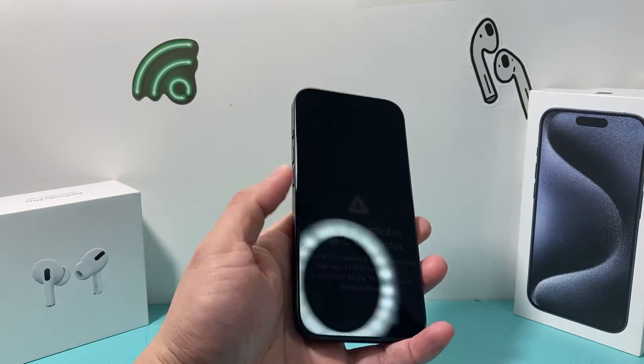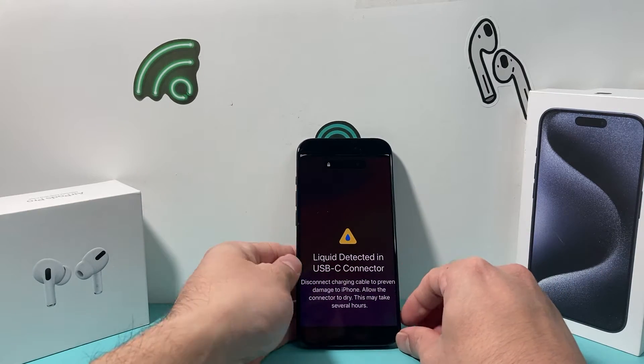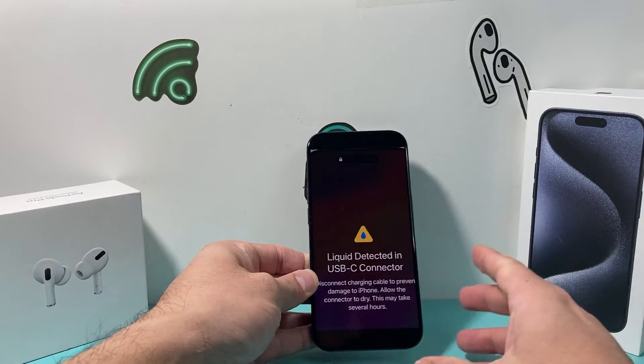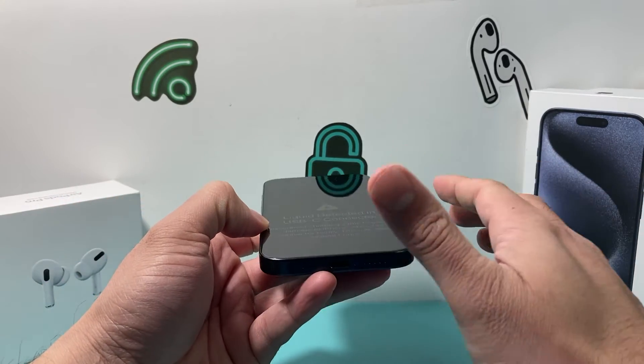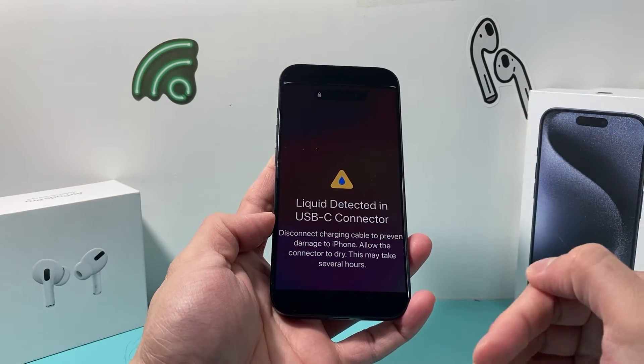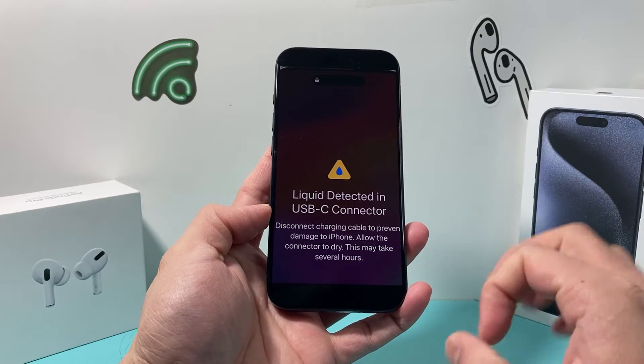You want to put your phone in an upright position like this. If you put it down somewhere, keep it in an upright position where there's airflow so that the water can actually come down. You don't want to lay it flat because the water will just sit there. You want to let the water inside drip downward.